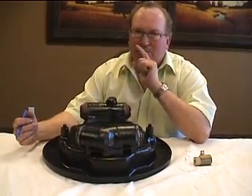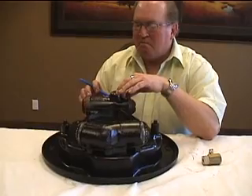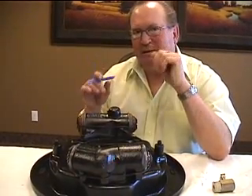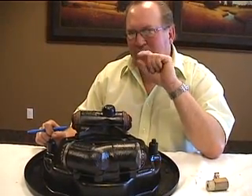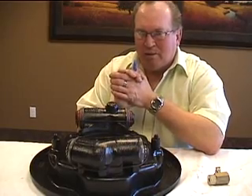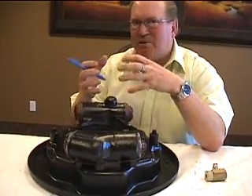First thing you've got to remember is that your master cylinder is full of dirty brake fluid. You've got cylinders here with new sleeves that are polished to a mirror inside, and you've got cups — inch and three quarter wheel cylinder style cups — inside here on pistons that run back and forth. Now imagine if you had grit and dirt in your brake fluid and you pumped your brake pedal, sending all that dirty brake fluid inside these cylinders. It scratches the bore.